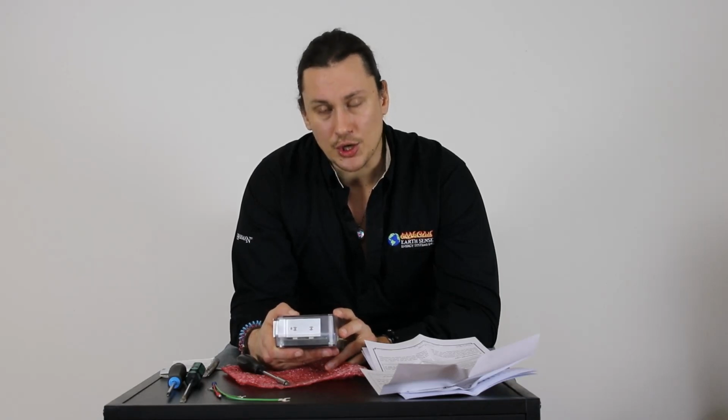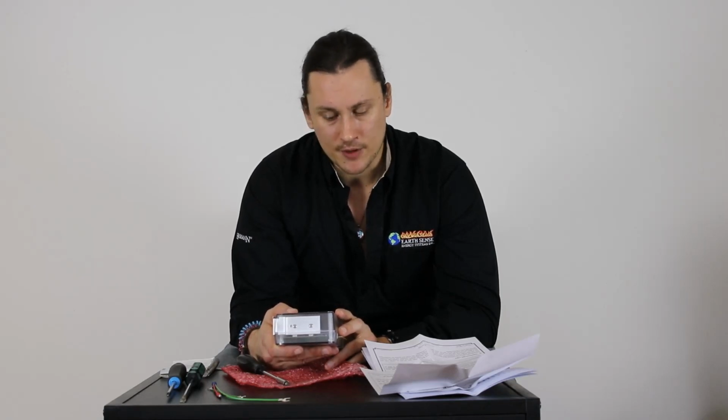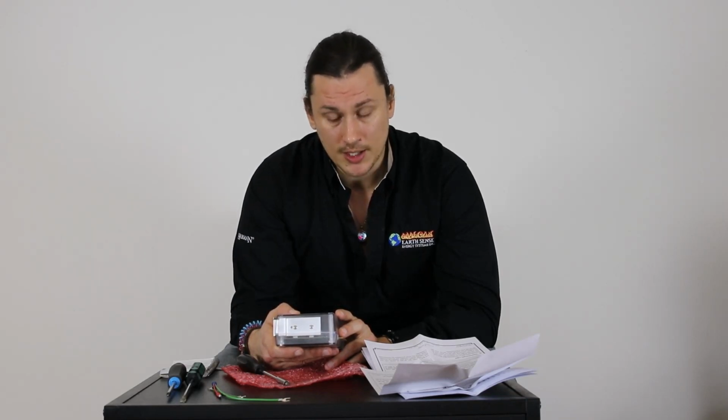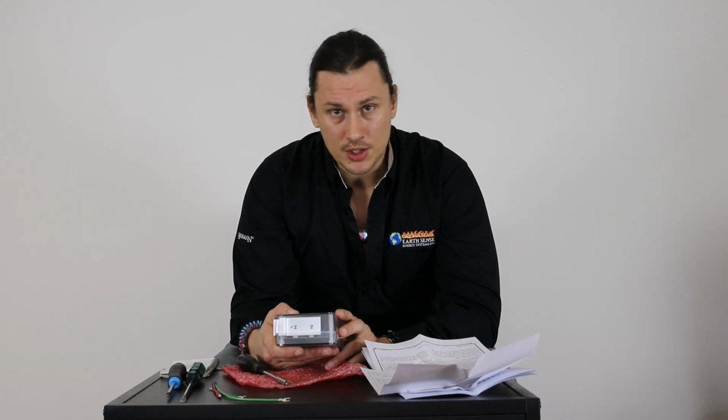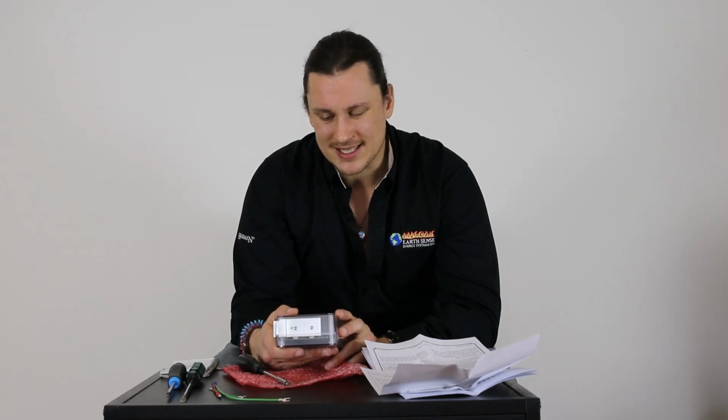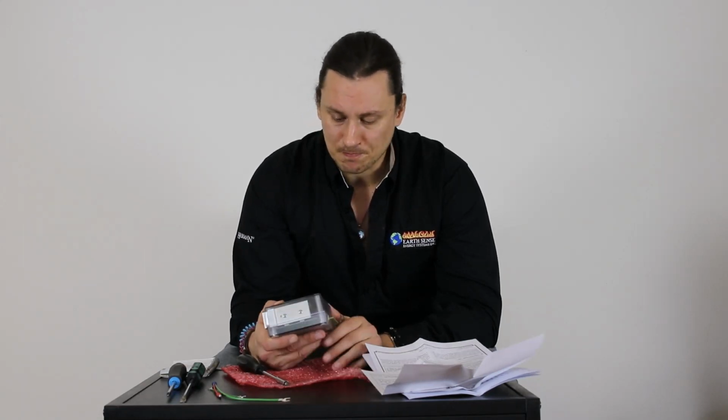If there is an issue and you do see that blink, first thing to do is obviously just give a physical inspection to that thermocouple, make sure that it's secured correctly and properly, and then also just pull off the cover that's on the thermocouple, make sure that it's properly over the fire pot, everything looks good with it, and put it back on. If you're still having issues once everything is checked over and seeing that blinking amber light, would probably be an indication that the thermocouple itself needs to be replaced.